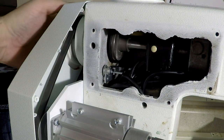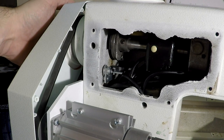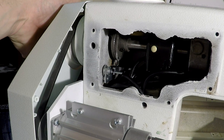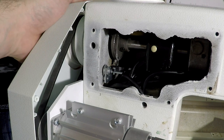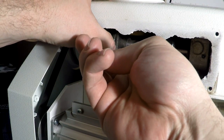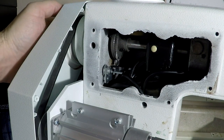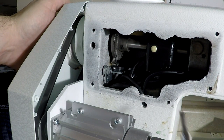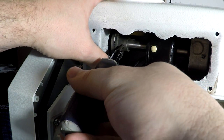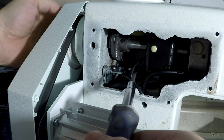After that, we'll turn it one rotation again back to top dead center. Right there. Then we can just very gently push that back where it needs to be, right above that sensor. We get the screwdriver to the screw and, without moving the collar, just very gently make that snug again.